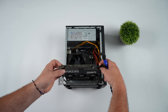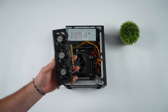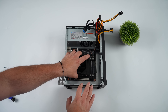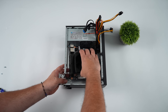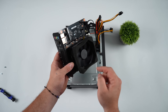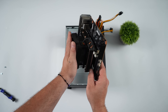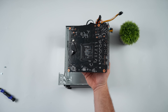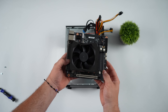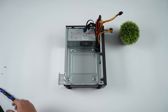So we'll go ahead and get this thing apart. First up, we'll pull this GPU out — and trust me, this stuff is not going to go to waste; it's going to go in another small form factor PC. We'll get the motherboard, CPU, and cooler out. This is kind of an all-in-one unit from Minisforum. I may reuse this fan — I know it's a bit smaller than what we can install on these boards, but it's got that foam tunnel on it. Once we put the side panel on, there's a cutout, so it draws cool air directly from the side and blows it right over the cooler. It does a great job up to around 100 watts, so I think it'll handle the X3D version.